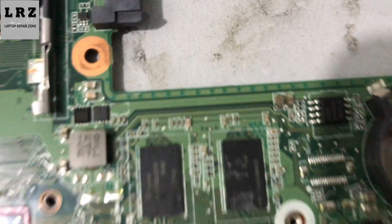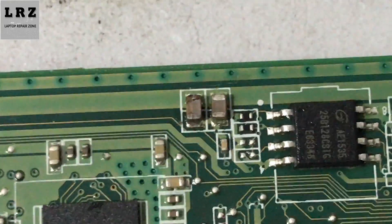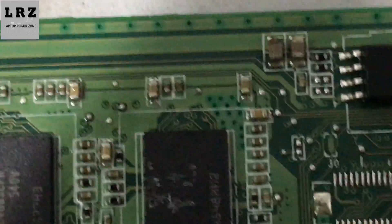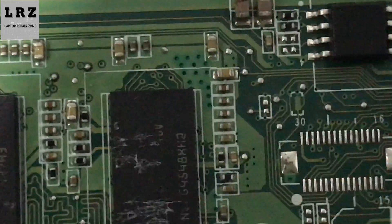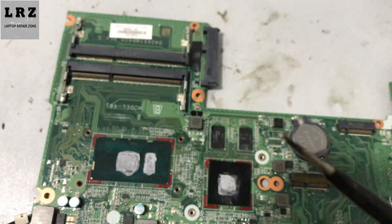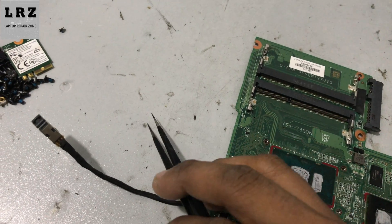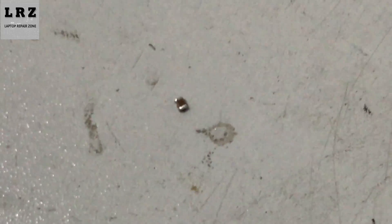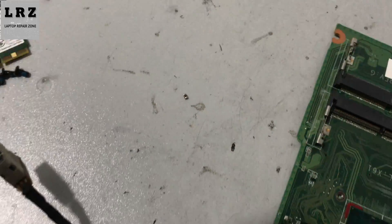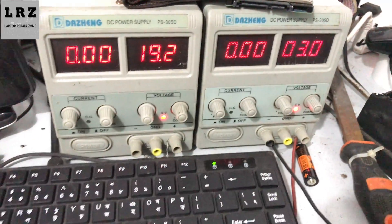As you can see, this motherboard is taking ampere, so let's find out which part is shorted. We already found it — as you can see, this capacitor is generating too much heat. So I just remove this capacitor with my tweezers because it's too hot. This capacitor is the 18.5 volt filter capacitor and it was fully shorted to ground. I don't need any hot air gun or soldering iron — I just remove this capacitor with my tweezers. No ampere is being drawn now.